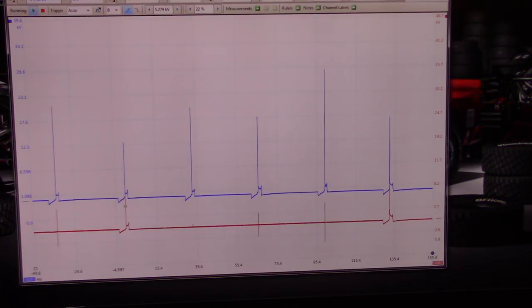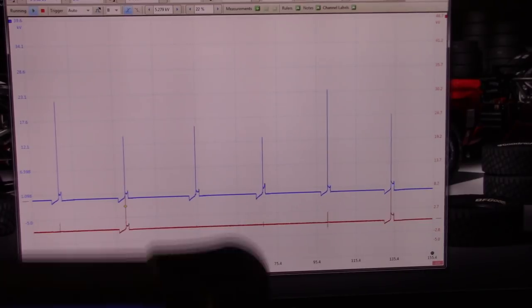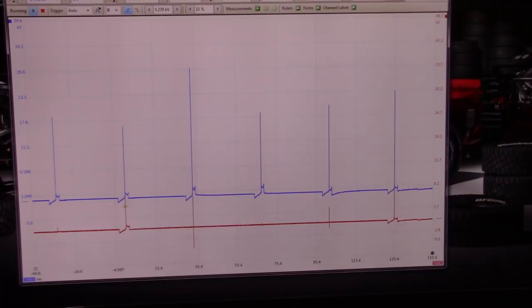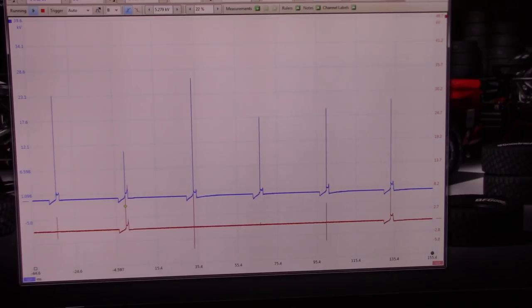All right, so I don't feel any misfires, and I don't see any misfires caused by fuel or by ignition. And look at the counters. Now we're at 183 and going up on cylinder three. Engine is running good. I'm gonna put a towel just in case over that coil. Cylinder 4 is misfiring too, at 100. So 3 and 4.